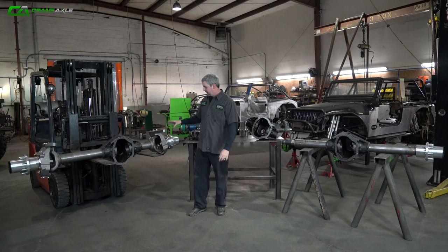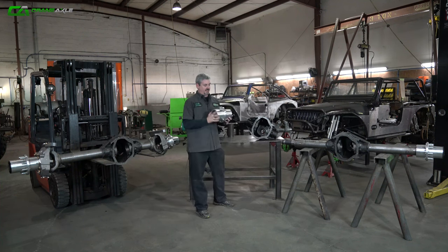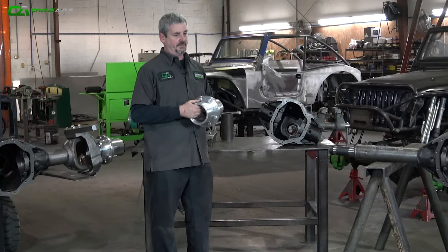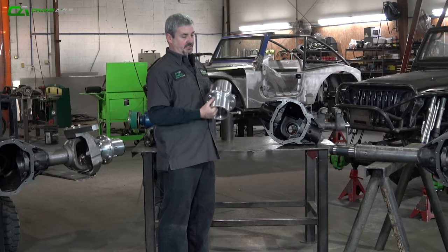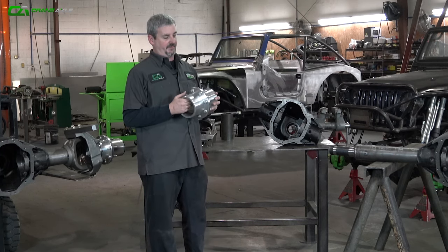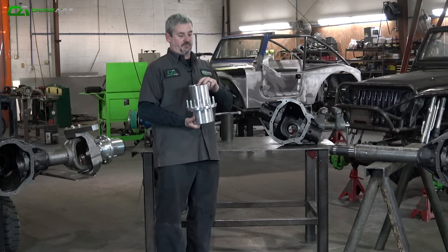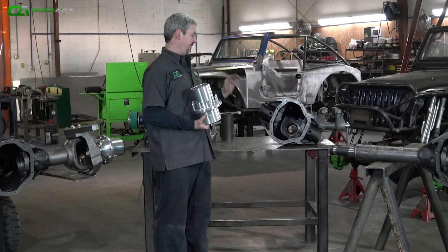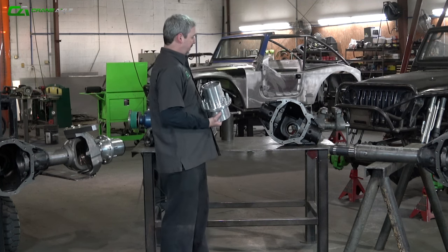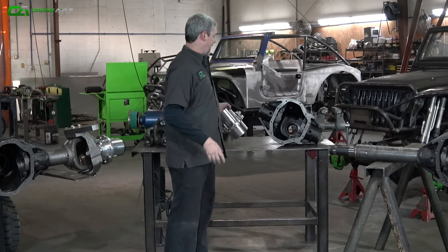So these things get an aluminum wheel hub. This is the lightest wheel hub on the market whenever you're talking about a big belt front end. Don't think just because it's aluminum that it's not strong. We've tested this thing time after time, never had a failure out of it. They are awesome. You can put a full 2-inch 47 spline axle shaft into this and a full 2-inch 47 spline axle shaft into our spool. Run that with a big belt axle and man, it's just crazy strong.